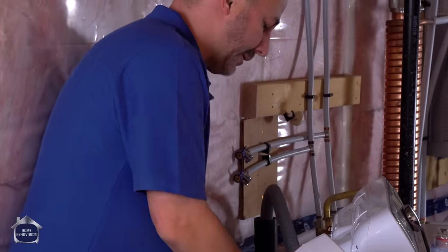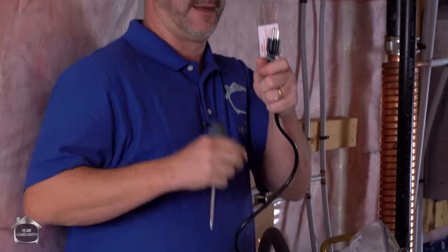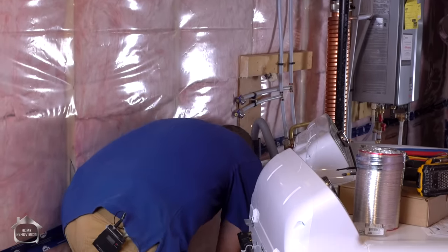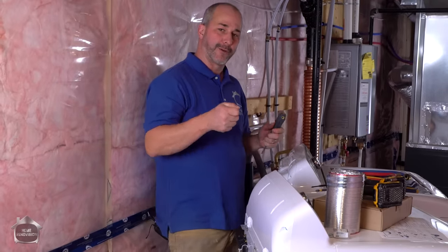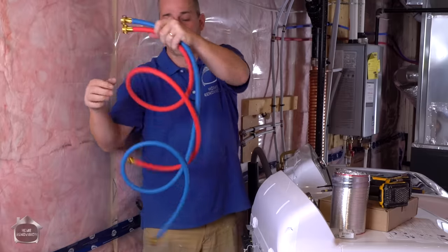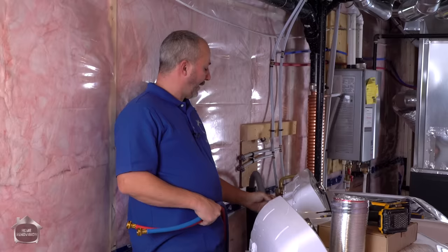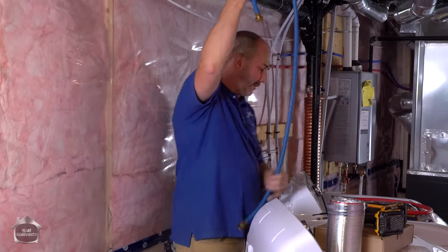The only other thing you've got here to deal with is you also have a power supply — it's just a regular cord and there should be a plug in the vicinity to power that up. Got to love those new modern plugs — you've got to push equal amount of pressure on each side or it doesn't let you in. And if you go out and buy a hose kit, they may or may not be color coded, so it's very important to pay attention to the back of the machine. There are generally going to be little blue and red plastic fittings, or there will be words or a picture — make sure you connect the hot to the hot and the cold to the cold.